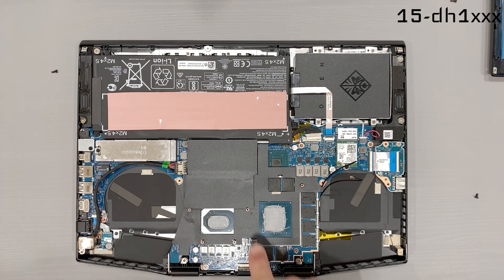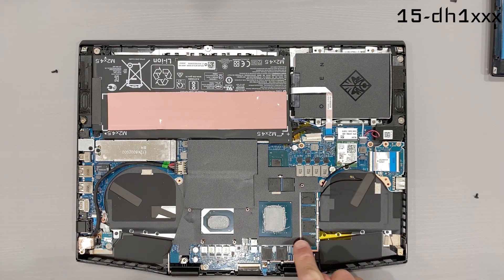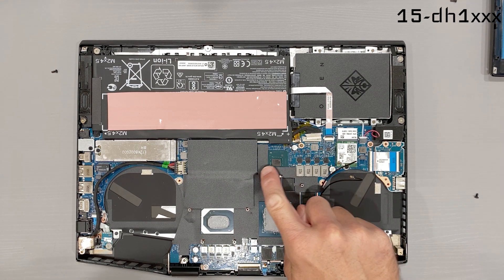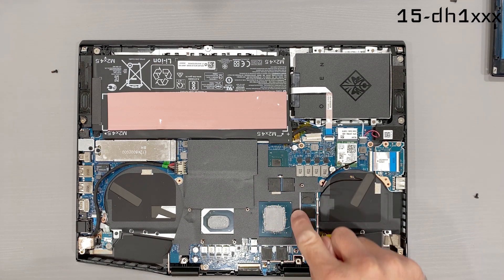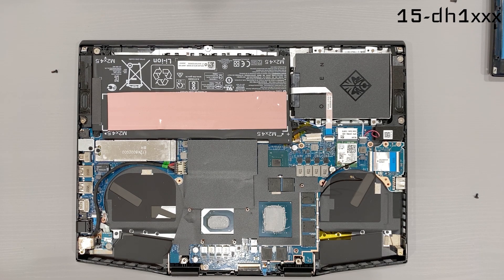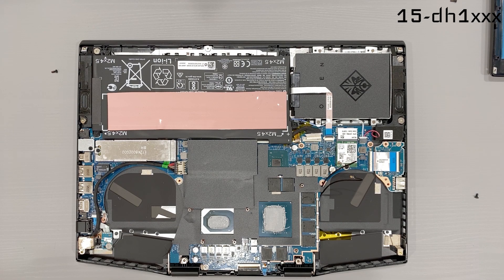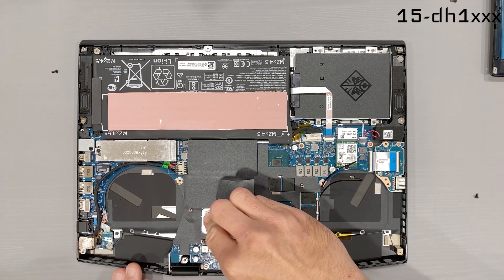Now I'm not particularly fond of this black cover and how it covers the right edge of the CPU PCB area. That silver trim is raised as well, and this will further reduce the physical space that can be occupied. The CPU side of the cooler is flat, so any material on the PCB surrounding the CPU die can prevent proper contact of the CPU die and copper cooling plate.